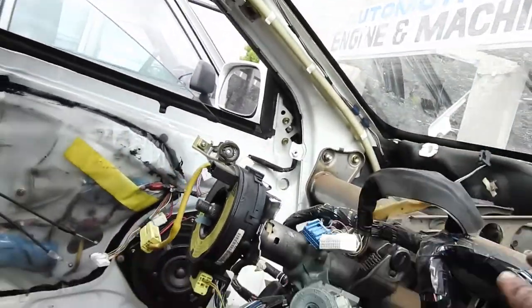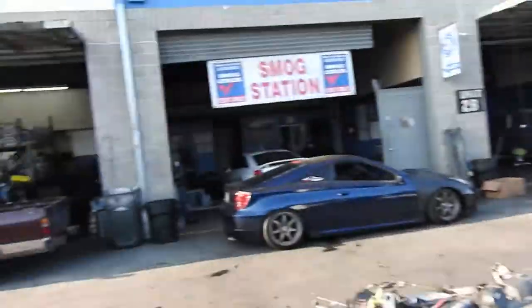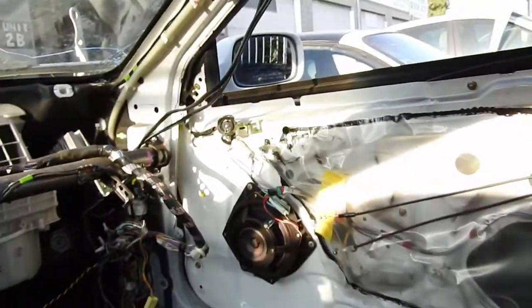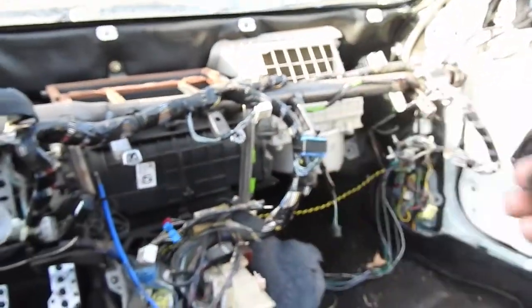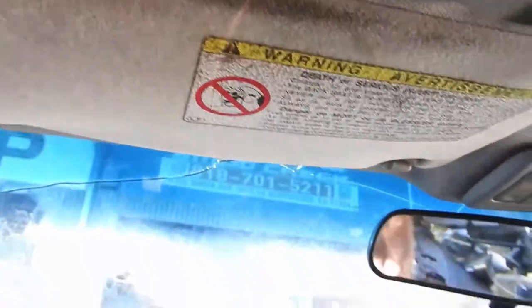You also have to take off the steering wheel and all the little sensors that go on the dash — that's the automatic headlights, the alarm, the window switch, and that's it. I'm also swapping out the glass sunroof for the plastic one. That one's pretty easy — it only has four bolts. You've got one here and one there, same on the other side, and then it just comes off. Going to do the other side and then start working on the dash.